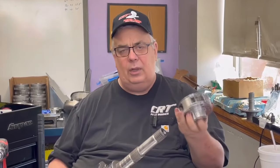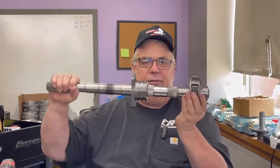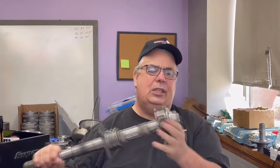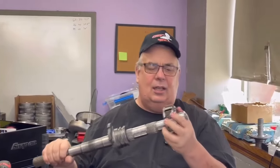So I told Jeff, hey, listen, if we're going to go to a low ratio, he already bought an aluminum set. I'm like, can we get the steel? So Jeff is upgrading from an aluminum 3-pinion to a steel 6-pinion front planetary. Now, don't forget, this is splined right to the shaft, which goes right to the output shaft or to the drive shaft. So this is direct. There's no cushion from a converter or from bands or clutches or anything. This is hardcore straight to it. So this upgrade that Jeff's going on for his T-Bird is going to be awesome.